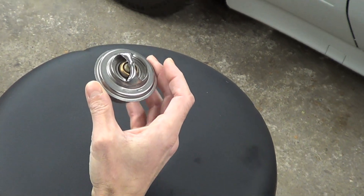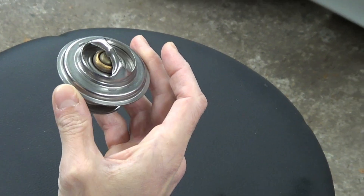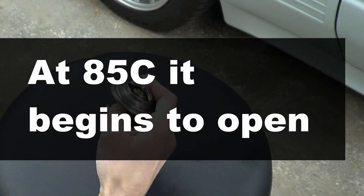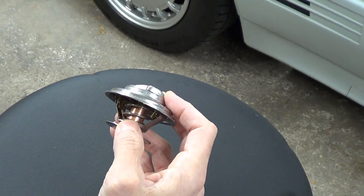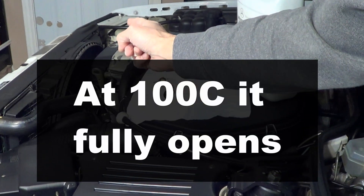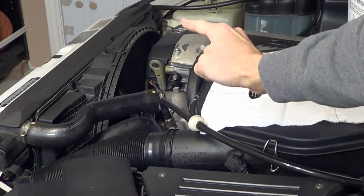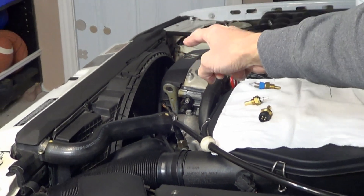The Mercedes were all originally equipped with an 87 degrees thermostat. So between 85 and 90, it begins to open and allow circulation from the engine to the radiator, but it's not completely open at those temperatures, just a bit. At about 100 degrees Celsius, it completely opens and allows the coolant to freely flow from engine to radiator, radiator to engine, and so on.